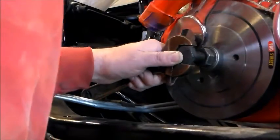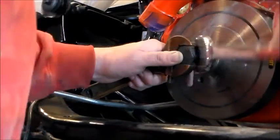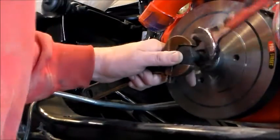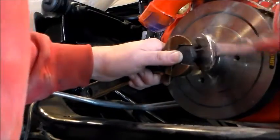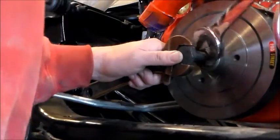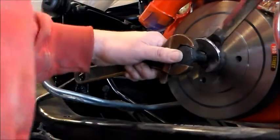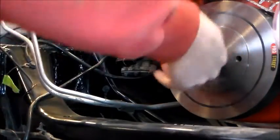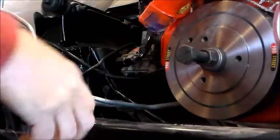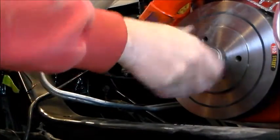It's going on nice and slowly, not getting caught. You just take your time and keep going. When it's done, you'll feel it — it'll just stop. There it is; it's buried right up against there. I can just back off my nut, and once my nut's backed off I can take my bolt loose and the balancer's on.